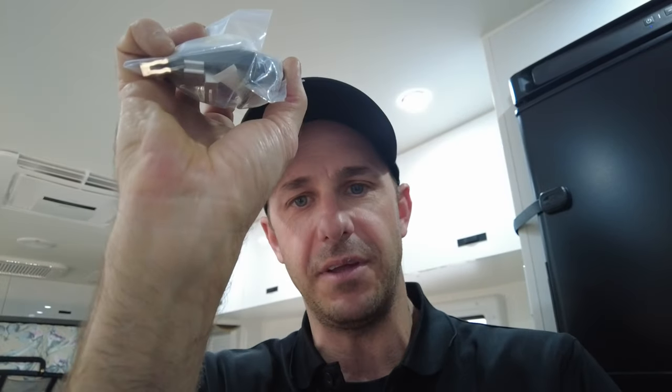Now, obviously, when you've got a poly tank or a water tank, you're not going to stick them on with a magnet. Even with a metal tank, I wouldn't do it. The water tanks come with a separate little mounting system, with VHB tape around it with an activator, very similar to how we fit solar on the roof of a caravan. So you crack your little activator glass bottle, you scratch up your surface, you clean it, and then the shroud sticks straight underneath it, and then you push it in place. And if you ever need to replace the battery, you just pop it off.